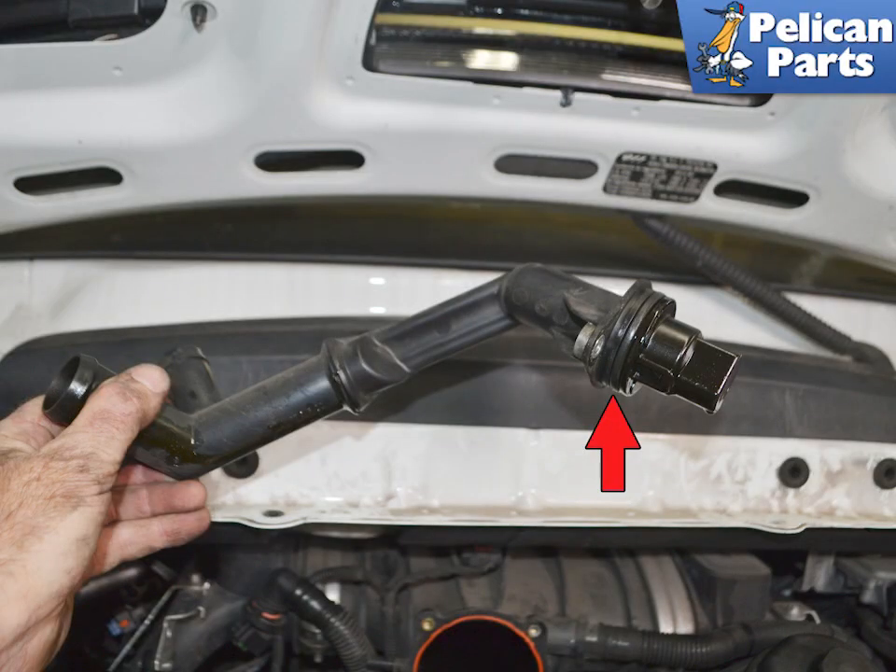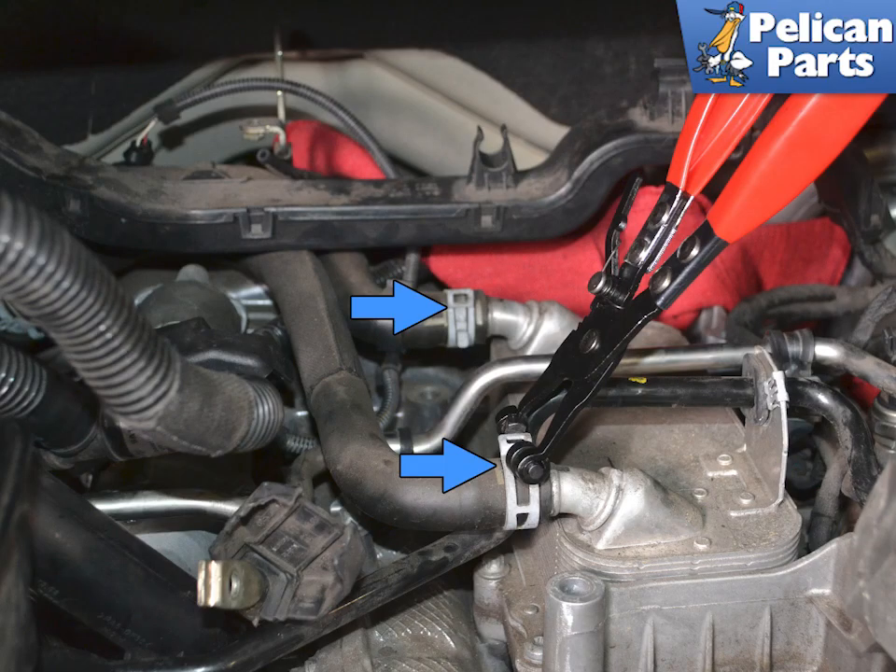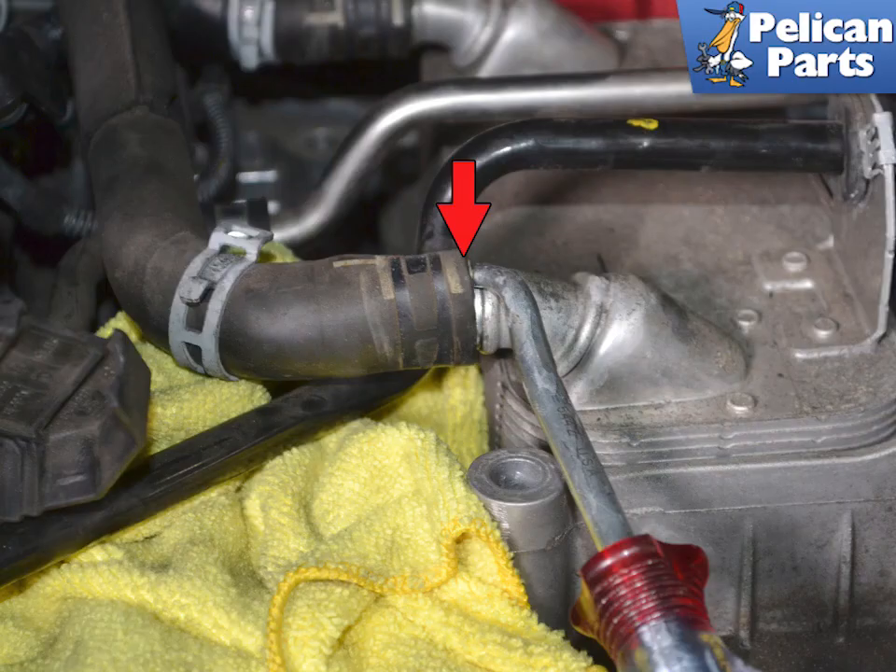Remove the oil filter tube and remember to replace the gasket. Using proper hose clamp pliers, remove the two clamps on the coolant line to the oil cooler (blue arrow). On vehicles with PDCC, hydraulic lines are also fitted on the heat exchanger or cooler — your cooler may look different than this one. If you have not drained the coolant, this is where you would use clamps to clamp off the coolant hoses going into the cooler. If needed, run a pick around the inside of the hoses (red arrow) and separate them from the cooler. Inspect the hoses and replace as needed.